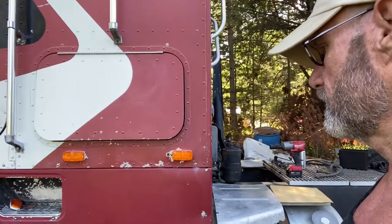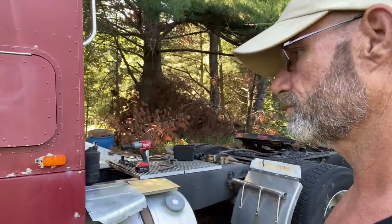I see there was something else I wanted to tell you. Yeah, I think I told you. I wanted to tell you about the strap. But today we're gonna work on that shock mount. I wanna see if I can get that nut off and get some more penetrating oil up inside that bolt. On the other side, I got the nut off the first time I tried it. And I've been squirting it now and again with penetrating oil. I'm gonna squirt it again today, but first I wanna try and get this nut off because I've been squirting this side too. So let's see if that penetrating oil made it possible to get that nut off, shall we?